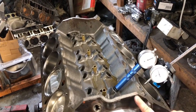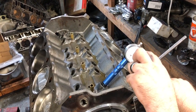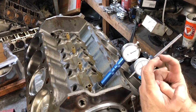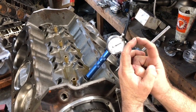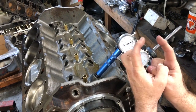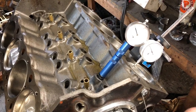The lobe of the camshaft is elliptical, so it comes up and goes down like this. This point here is where I want to find the intake centerline in degrees on the crankshaft. You can't just say this is peak lift — you have to go on the back side and on the front side. It's the exact same way that I found top dead center.